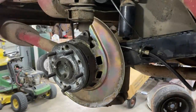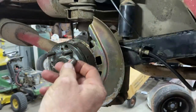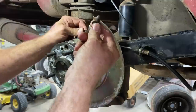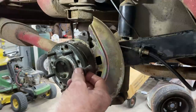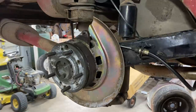All right ladies and gentlemen, the saga continues. I went to tighten up the bolts on the caliper and this one here just sat and spun. It is definitely stripped out on the end of this bolt. The threads look okay here in the mounting tab, and I know they're definitely okay on the other side, so I'm going to have to find me one caliper bolt and see if it's going to work. Because I am not going to send this thing out with a stripped bolt on a brake — that ain't going to happen. So we're going to have to see what we can do. Also got to find some little tabs for these right here to hold them up. All three of those have broke.